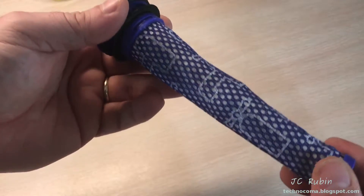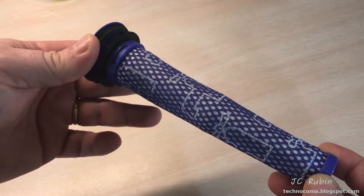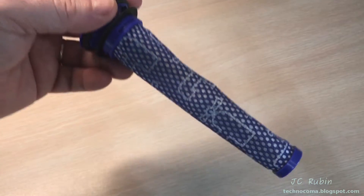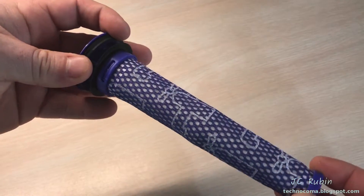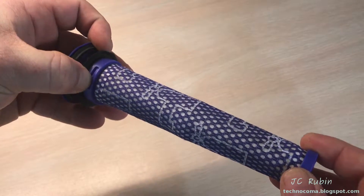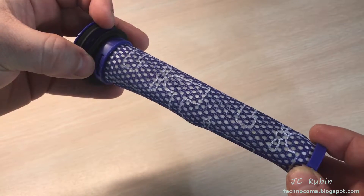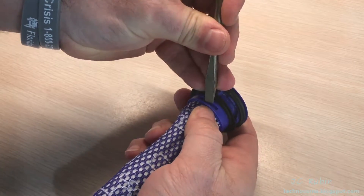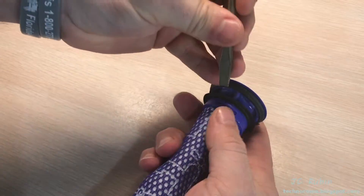There's no way around it because all you can do is wash it out, but you end up with a wet filter again — the minerals don't come out when you wash it, and you further build upon those minerals. It could also be argued that a lot of the dust you vacuum up could have some mineral content. So I'm going to clean this filter with water as normal, dry it out, then dissolve the minerals with vinegar, rinse with distilled water that has no mineral content, let it dry, and then evaluate performance for both methods.